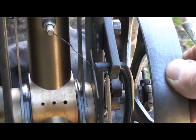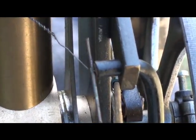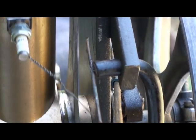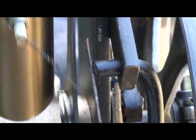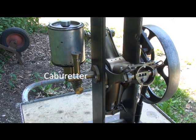I don't know if it's visible — the spark, a bit closer. It's only a little spark. The engine has a simple carburetor, and the fuel mixture is sucked via a leaf valve into a hollow mainshaft into the middle of the engine.